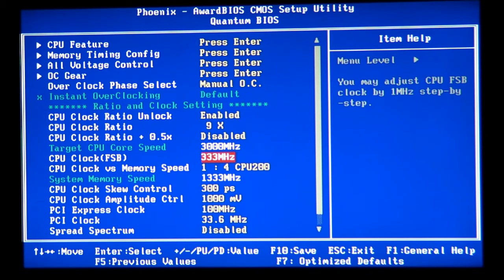I'm running 3 GHz, so I'm going to go to 3.2. Let me set 400 on the front side bus — that's going to give me 3.6, which is too much. I suggest you go 200 MHz off, so let me set 360, which gives around 3.2. That's fine.